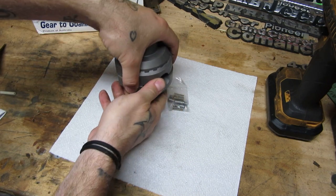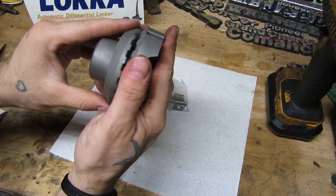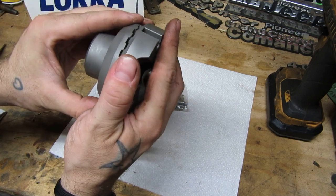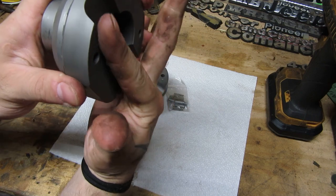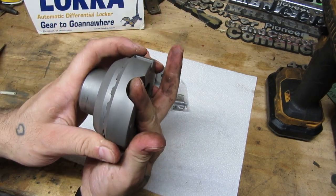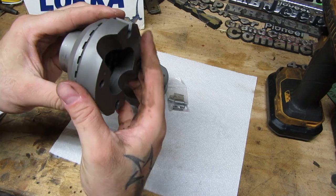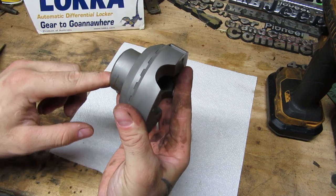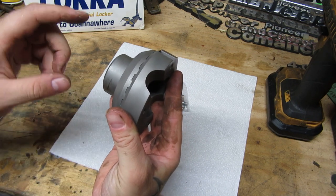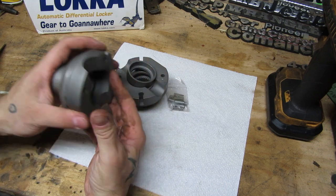Remember, you've got the center pin in here, so these two are always moving as a unit. Now these outside ones, which had slack to slip past each other, are now locked into place so that slack can be in the middle. That's how this works — that's where the magic is. Under normal driving conditions your drive gear and cam gear move just fine. Whenever your center pin is torqued so that it's putting more force on the cam gear, it pushes in and these lock. Your two drive shafts are locked together and now you have more traction.